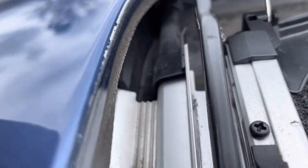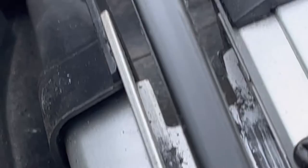If you look at it, all the way up under the dash, there's the drain. And that one goes through, it looks like it goes through the firewall. So we'll have to see if water is getting to that point and getting clogged. Okay, so we're looking at the drain, the sunroof drain is kind of hard to see, but if you look closely under that bar right there, the railing, there's a little hole and it's a drain. Okay, so water is coming from higher up here.